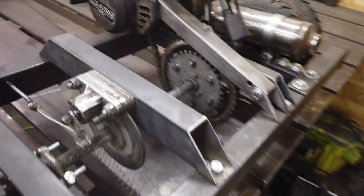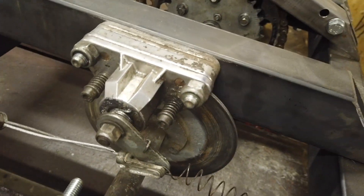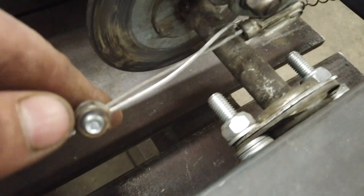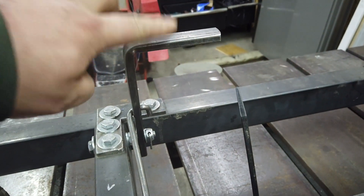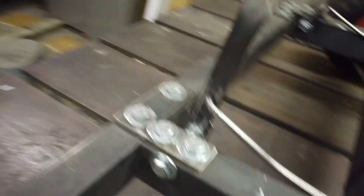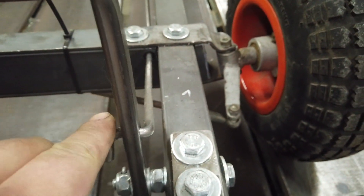The rear brakes are really simple. I cut a little piece of tubing, 40 by 60, drilled two holes — one here and one here — and just bolted it on the caliper. The brake system worked out quite easy: a little bit of cable and bolt. I drilled the holes and put a lug like this. Then it runs on 6mm solid metal wire. The pedal I bent from 10 by 20 tubing, drilled holes here and here, put some spacers and cut it so it works nicely.